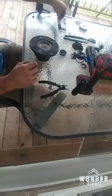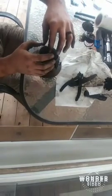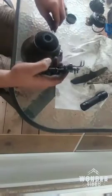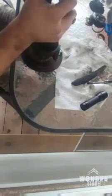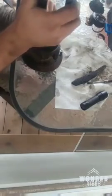Take the thrust washer - it has a roll pin and an oiling hole, and that's how you know how it goes in. The oiling hole has to match up to the hole there; just drop it in and it sits in there just like that. The oil deflector lip goes inside that hole. From here put the big snap ring in, then go to the back side and install the final journal bearing. Lube it up, slide it right down in there, make sure it's straight, take a flashlight to confirm it's seated all the way, then install the final snap ring and make sure it's fully seated.